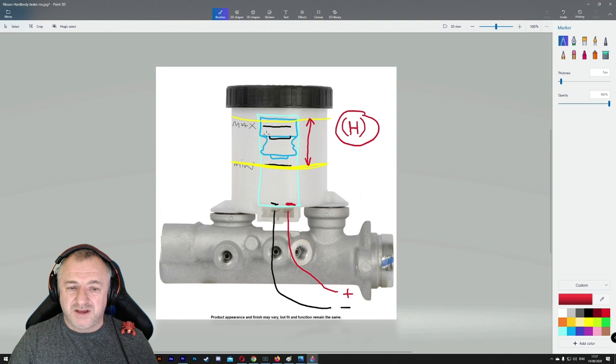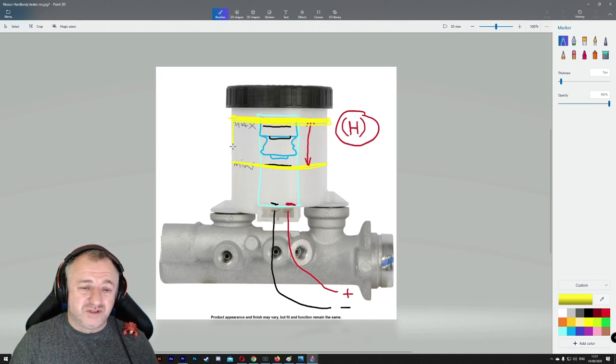And this was a wonderful idea, except for one problem. Every time a car gets serviced, we do the same thing and we top up the bottle. We've all just done this; we've naturally just followed the set of guidelines. When a customer's car comes in for service, we top up the bottle. And this is why, when we push the pistons back, fluid all of a sudden comes out of the bottle, because it's been topped up too high. You would have seen that when you push the pistons back, it would stop on the exact max mark, it would be perfect, and that would tell you that no one has topped up the brake fluid. But with constant topping up of brake fluid, we don't get that warning.